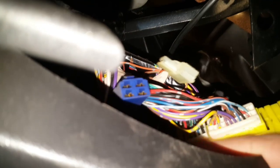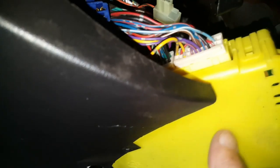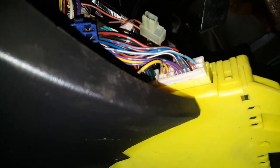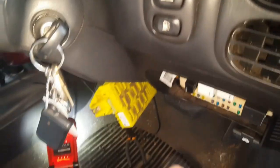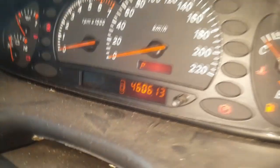With that out of the way I've got the box down here and I can drop it now if I take those connections out. There's a four-point connection here and one here - this is just a corner termination. I'd like to know what they're for - is there something that came with the Fairmont that I don't have in the AU Classic? I'm going to try and get this box a bit lower so I can put a meter on these leads to find out what's what.